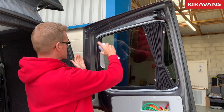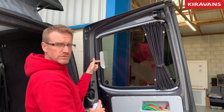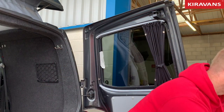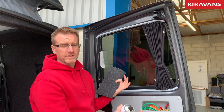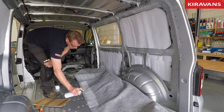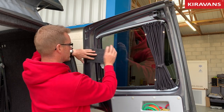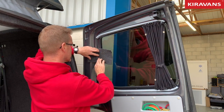Get your high temperature adhesive and spray that on your metalwork, right up to the edge of your rubber trim. That's got glue on it, and then you'd have your big bit of carpet for the side of your van. You'd spray your carpet and then stick your carpet on like this. This would probably be one big piece, so it would cover the whole window. You'd end up with it like this.